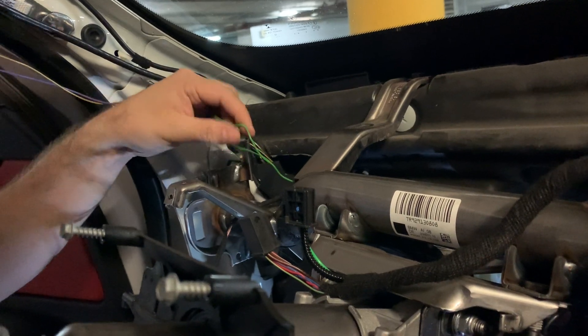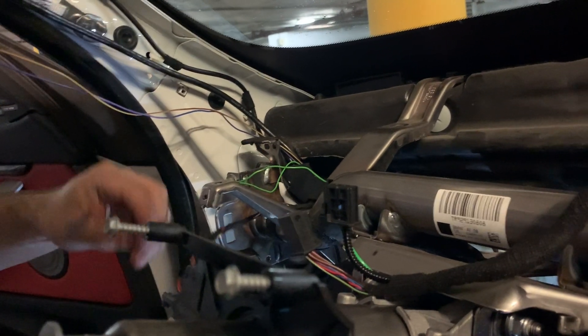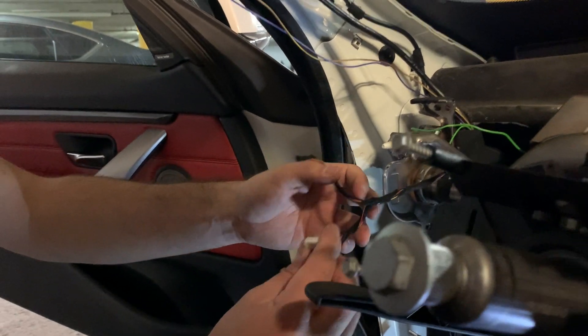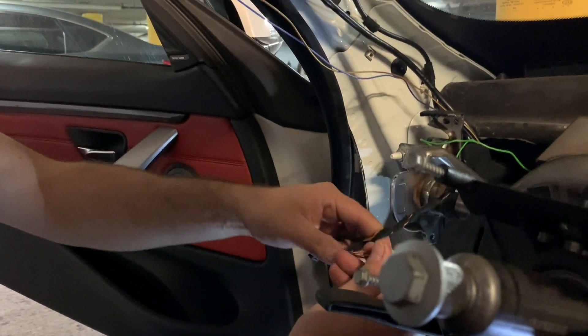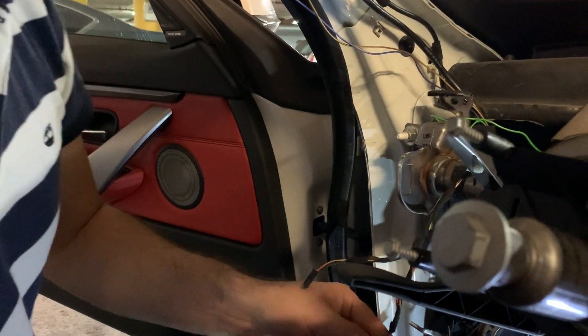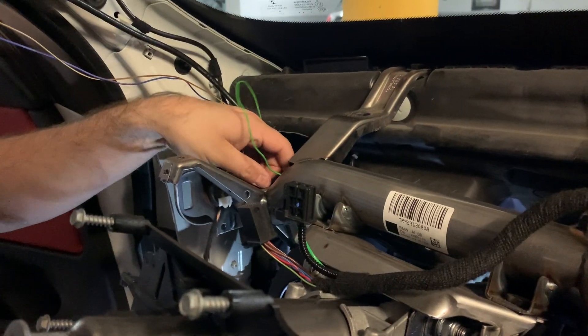There's a green wire that goes to the fuse box that we're going to attach to the OEM wire here — that's for the headlight switch and the controller for the lane change warnings and front collision. If you're going to retrofit this, make sure before you pass the cables that you check, because this wire was already tucked there with tape. I made my own cable for these three wires and then realized the wire was already there — that was a two-hour waste of time.